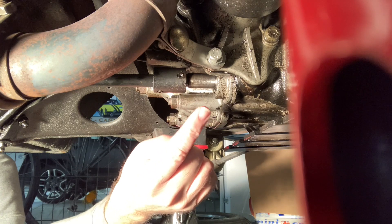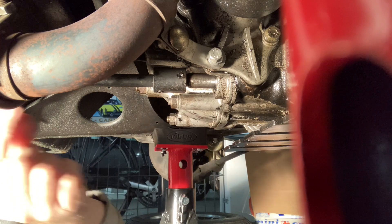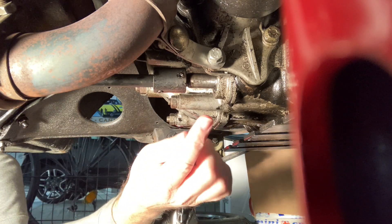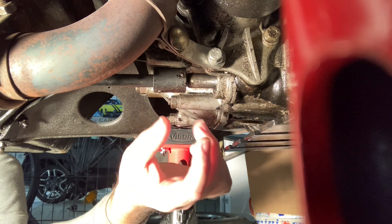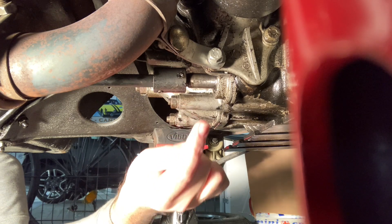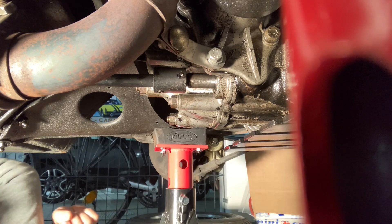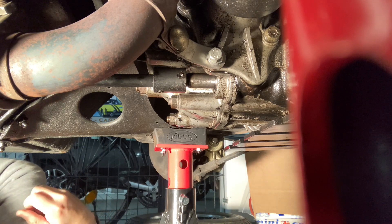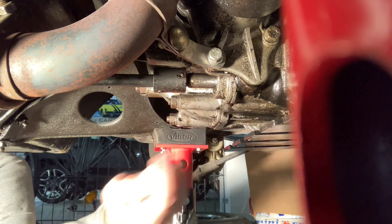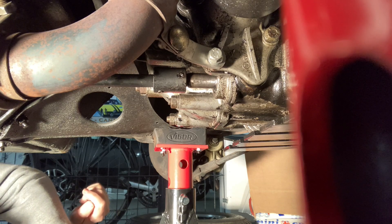The next thing we're going to do is the oil seal here. You can see the dripping oil. This is the rod selector and all we need to do here is separate it. That'll take the collar off and then you've got the two parts. With the two parts you can then separate it, slide that off and check what's inside, see whether we've got an inner ring to take out. If there isn't, we've just got to slide the new one on, slide the new seal over, and then I've got a flexible piece that helps protect that in terms of dust and dirt.